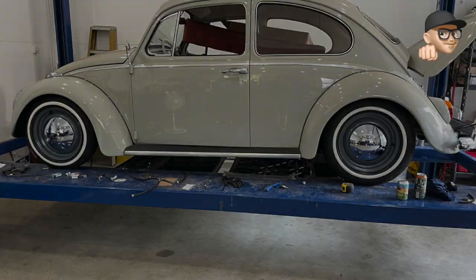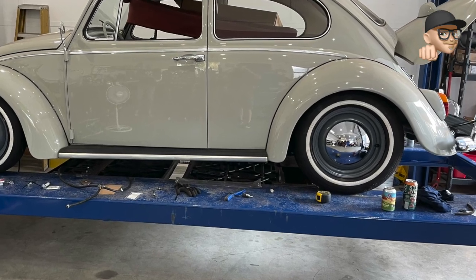Thanks for tuning in to episode number four of the build — we are not done yet, probably into a fifth or sixth video before this thing's done. Since the last video I've had the back end pulled apart twice to get it to the right ride height. There are about a thousand videos online showing how to do it, but there was a little indexing problem I had to work through. With all new rubber in there it doesn't all fit together easily — there's a lot of fiddling around involved. Anyway, that's all done, there are all new bushings in there so it's going to ride a little bit nicer.